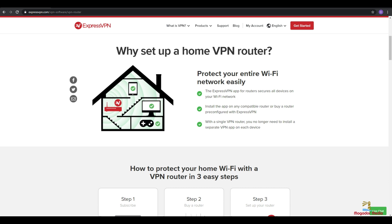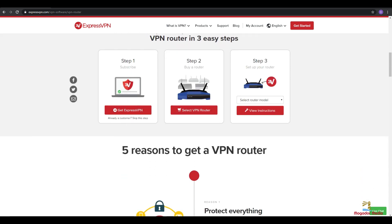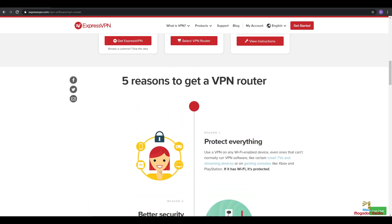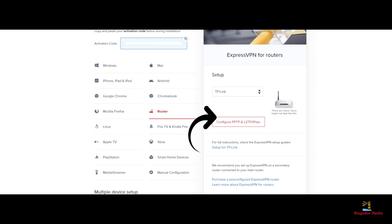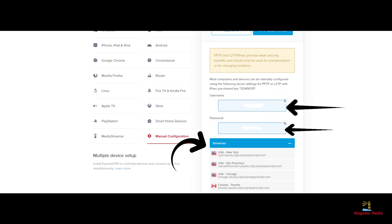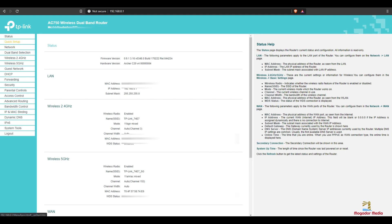For this part, I'm using a two-year-old TP-Link wireless router that supports VPN. Nowadays there are even more routers that support VPN. I like configuring my router to use VPN — that way I know every connected device I want on VPN is covered, and you can always turn it on and off. If you have an ExpressVPN account, here are the steps: login to your account, click on Router and find your router in the drop-down menu. Next, click on Configure PPTP and L2TP. Copy the username, the password, and the server address. Now go to your wireless router configuration page. The default IP address can be found on the back of your router or by entering the command 'ip r' in your terminal. Just enter the configuration settings from your ExpressVPN account and you'll be up and running in no time.